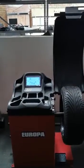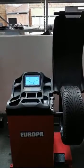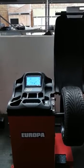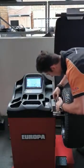We're going to show you the Europa 825L, which is a fully automatic wheel balancer — not a laser balancer, but a fully automatic wheel balancer. We're going to show you how the arm automatically measures without having to put in any information into the machine.